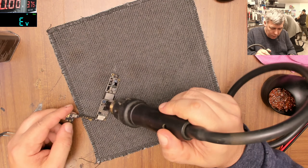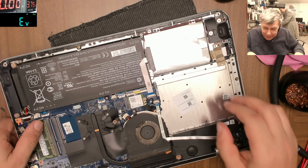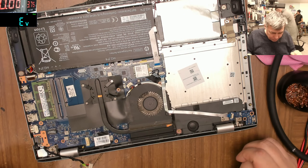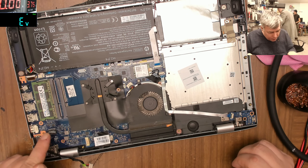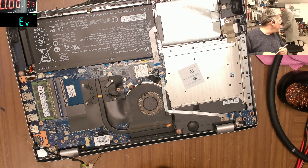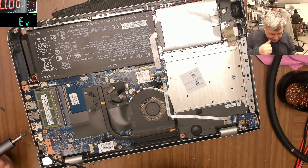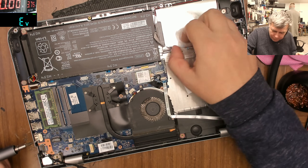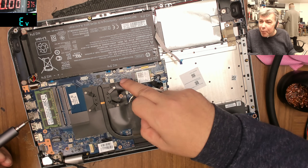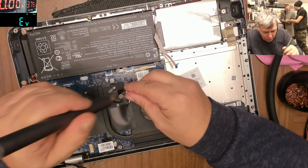Let me dry the board quickly. Now about this HP laptop - this is stupid. The charging port has a shield, the shield is behind the hinge, and the hinge is behind the motherboard, which is insane and crazy. And obviously even the motherboard is behind the battery.